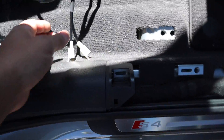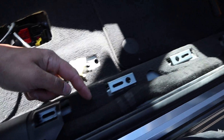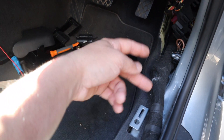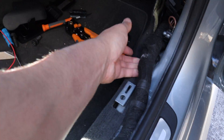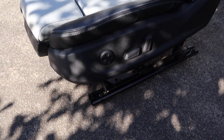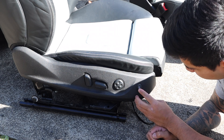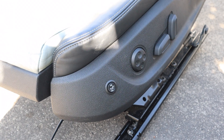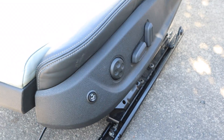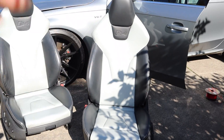Here are the powers on the driver's side — there are the two heating element plugs and the plug for the switch. I ran the wiring down here and met it with the two wires I brought across from the passenger side, put some plugs on them, taped them up, and put them away underneath this panel under the carpet. I've also removed the switches from the kits and now we're going to look at where we want to mount them on the seats. The switches are done — I'm happy with that position, sitting within good reach of the other controls from both the driver's and passenger's seat. I'll clean up the seats first and then we'll put them in the car, plug them in and test them.